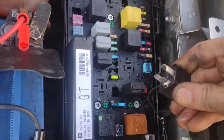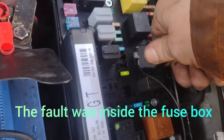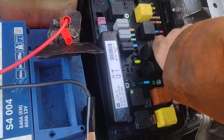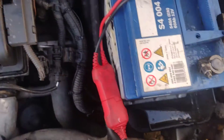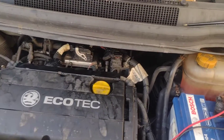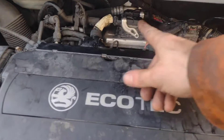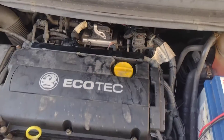What I've done is just soldered a wire to bypass the contacts in this fuse box. So we're getting past all that — the wire's going to neatly go down, cable tied out of the way. It's just an overlay for now to get it going; it's a cheaper option if the car's getting older. That goes in there, the relay's working. It gets the ground when you want it to get the ground to energise the relay to make everything work.